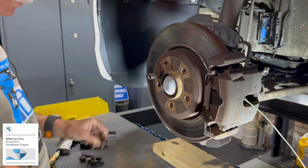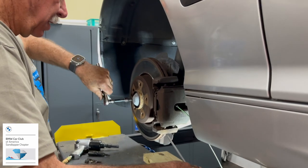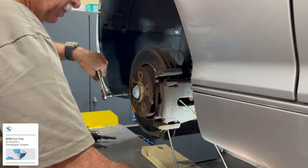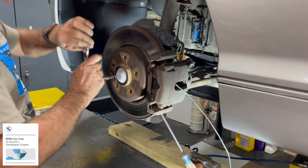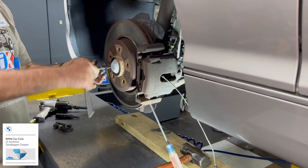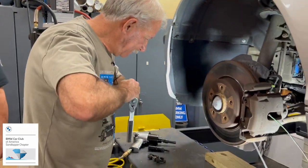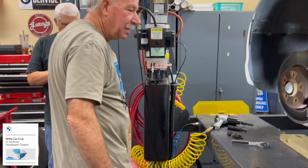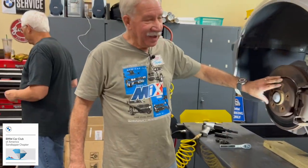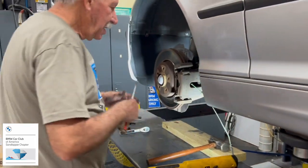There's a little screw that holds the rotor to the hub. Put in the tool. There you go. That holds. You give it a tap with the hammer to make sure the tool is in there all the way, the hex. Good. You hear the dryness. Just a little screw. You can replace them, they don't cost much. You can get them online. Fun fact, you technically don't need those, because the bolts are holding the disc to the hub. Germans like to over-engineer. But it'll fall off. The rotor will fall off.